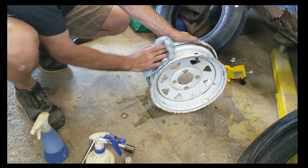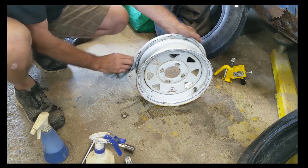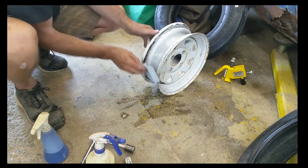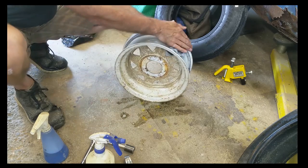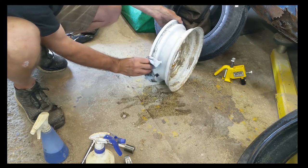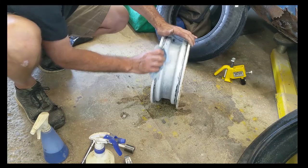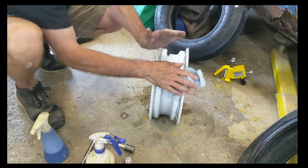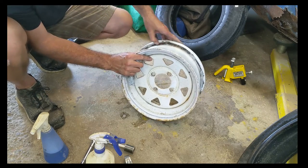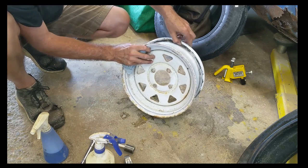It feels really good even though it looks scrap — there are no chunks or anything like that on it. Nice to clean the whole body of the rim too while you're here, give it the best start you can. I'm going to go with that old valve stem. Like I said, if it starts to leak, you test them after anyway, so I'll know as soon as I get it on there. It's a little rough right there — that's probably where it got flat and sat at one time.